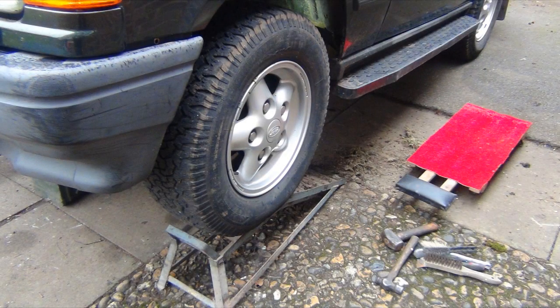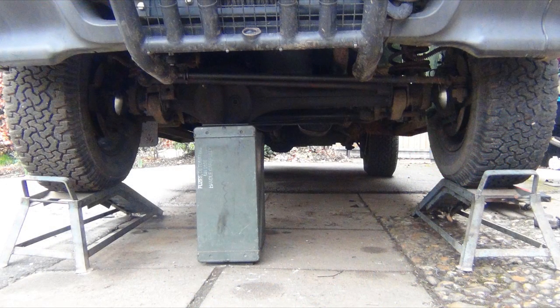The other side of this job is getting underneath the truck. We put the new piece of steel in and welded it in from the inside. Now we've got to get underneath it, seam seal the edge of the new panel that we put in, and just make sure all the joints are tight and close. There may even be a couple more spot welds underneath that we've got to do just to reinforce or tidy it up. Then we put the seam seal in, and of course we've got to under seal it - because if we don't get under the truck and do it from the bottom, which is where the weather is obviously going to get in, then the entire repair was pretty pointless really.